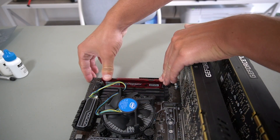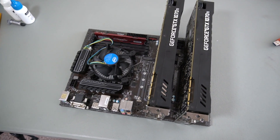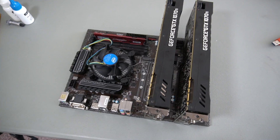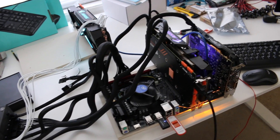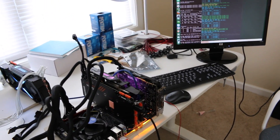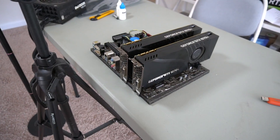Make sure you plug the CPU fan into the CPU fan port on the motherboard. Next, add some RAM - simply put it into your RAM slots. Consult your specific motherboard, but one stick normally works in most spots. For graphics cards, today we're using two 1070 Tis - PNY blower models with a single fan. Dual fan cards will also work fine. All you have to do is slide them into the PCIe slots on the motherboard.